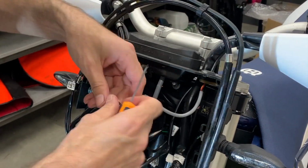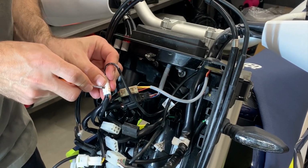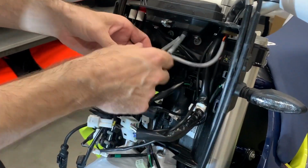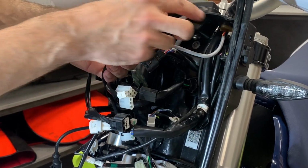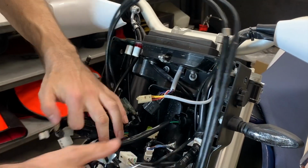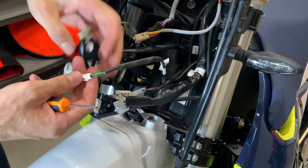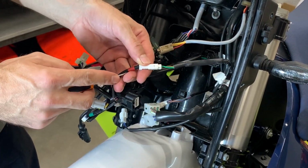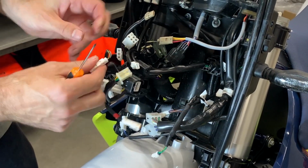Controls just the power. Here is the lock. So again with screwdriver. Up. Here is the speedo. Here is the tongue, and you pull. This is the ABS. You lift it up and you pull. And did I forget anything? Yeah, turn signals. It's good to mark them for later. Yes, so the red is the left one, and green is the right one.